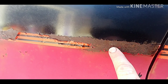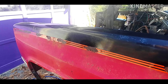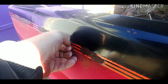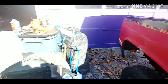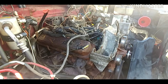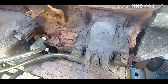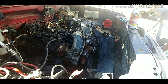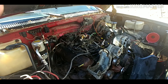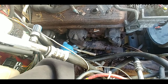It's looking pretty good. I'm gonna spray some gloss black over it and I still got a few spots I want to get degreased and wire wheel a little bit, but everything is looking real good for this budget build. I got a couple cans of spray paint in it, and then I went through the body and sprayed that rust reformer in there — it turned it black to neutralize the rust. I'm trying to get to all the rust. There's quite a bit to fix, but it turned nice and black. Up here where this pinstripe was holding moisture in, I just sprayed that black, and one more treatment and that rust will be neutralized.